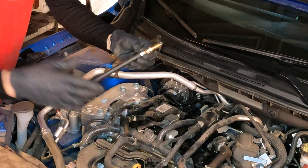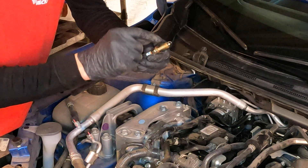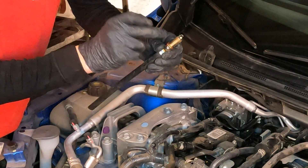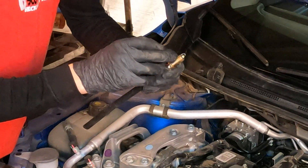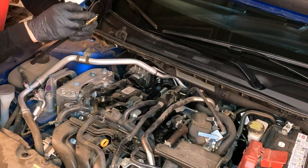In this situation we're just seeing if the vehicle needs any maintenance. With this spark plug it doesn't look too far off. If you think yours is bad, the factory specification on these is 43 thousandths of an inch of clearance for the spark plug gap.